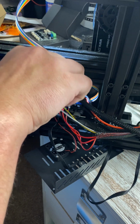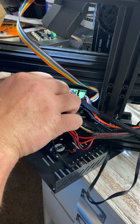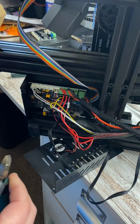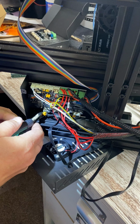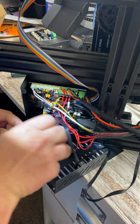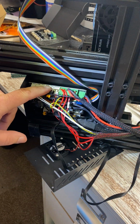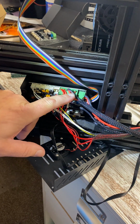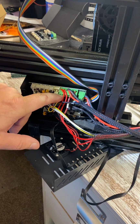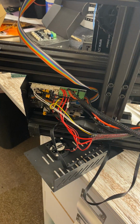And you can do it in a bunch of different ways. I'm just grabbing my snips and pulling a little bit. You'll remove this glue. And you don't need it, of course, because, well, we're putting in a brand new board. And like I said, it's on everything that's in here. So you're going to have it on your driver motors down here. You're going to have it on your bed, your heaters for your sensors up here. The only thing that's not going to have it is going to be right here on your mechanically fastened wires. And that's simply because it's fastened on there with screws.